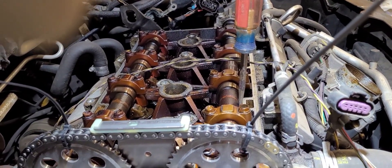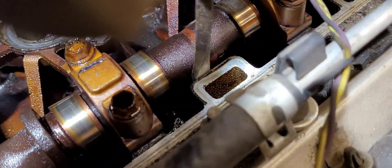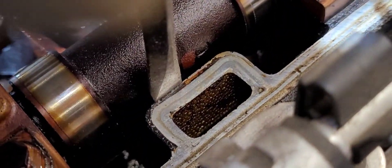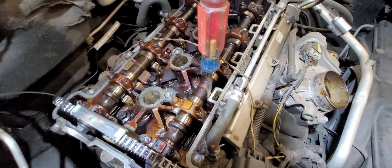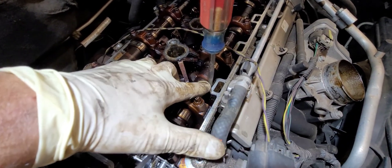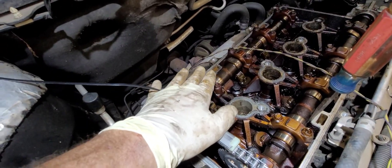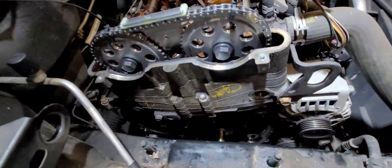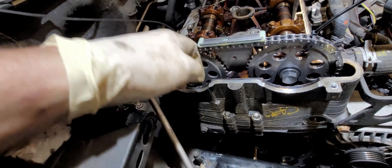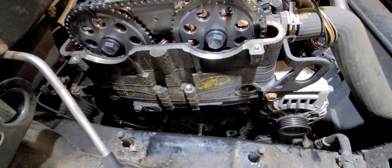You're going to notice the screwdriver here. There's a million ways to do this chain and I've done hundreds of them. I found that if you've got a Craftsman screwdriver — these Craftsman screwdrivers have little grippers on the tips — these cams like to turn when you take the tension off of them. I just tap this gently down and the friction between the cam and this aluminum oil return hole keeps the cam from moving. I keep this one free mostly and get this one fixed where it's supposed to be, then the crankshaft where it's supposed to be, and before I put this sprocket on, I put the tensioning guide down in, start that bolt, get it lined up on the crank, and then lastly put the other guide.